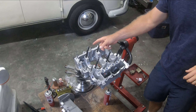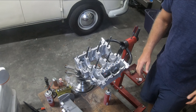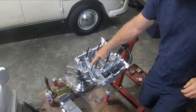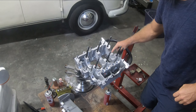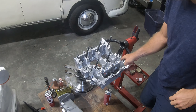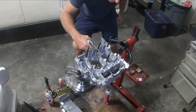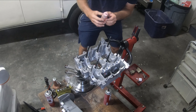I have this mounted and did parts cleaner on the whole engine case with all the passages. I put in these little dowel pins, the one-half main bearing, and the thrust bearing for the cam as well as the other two. What I'm going to do now is try to fit the crankshaft on there and see what happens. First, I'll put a little bit of oil on the main bearing with a tiny bit of assembly lube.